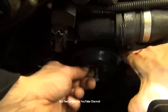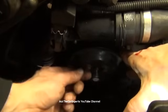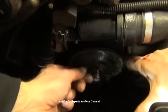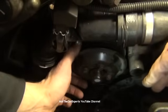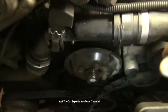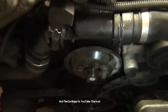You have the mechanical fan, you can put a little bit of that anti-seize on the threads here too. And these threads are cut much better, you can tell already. Alright, that's on, but remember it's loose. That's a big step that I think you might make a mistake on if you're not paying attention or rushing. You throw your belt on, you're done.